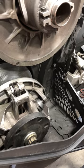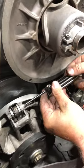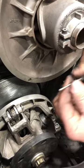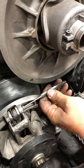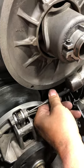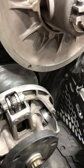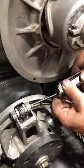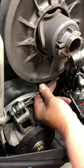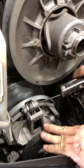Now we're going over to the cam assembly and doing the same thing. We loosen this — again, that's a tapered fit. This bolt head is a little harder to get to, so we found it's best to use a punch in here so we aren't damaging the Torx head on that bolt. This can get a little tight. Once you get it initially loose, it goes pretty easy from that point forward, and as you can see we're starting to come out the back end there again.